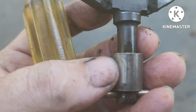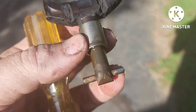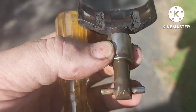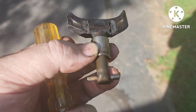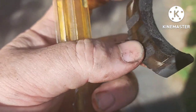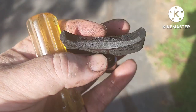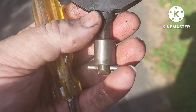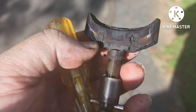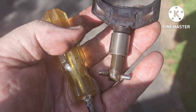You'll do that for all your power valves — clean them up and inspect your collar to make sure it's not missing anything. The problem with these was this tiny pin: when the engine would heat up it would vibrate out, the whole valve would drop down into the cylinder, and trash your cylinder. Remember when reinstalling these that the scalloped cut-out end goes down. You can note how you pull it out — the grooves cut in it are going to face down with that scalloped edge.